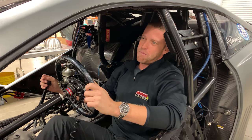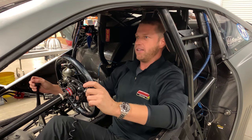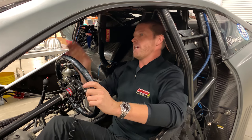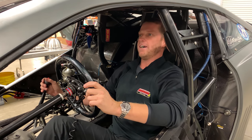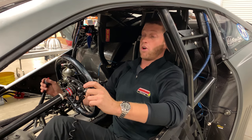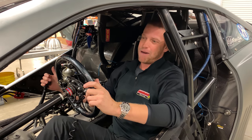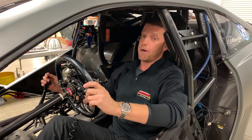Now, people back up with different styles. My guys included are talking to me on the radio, telling me left, right. Generally, I'm looking at my target at the finish line, and I'm backing the car up in the same target line that it's going to go down the racetrack. I shift my car to high gear. I back up decently fast, and I want to be able to back up fast.